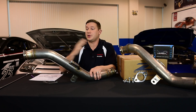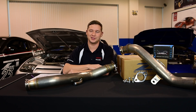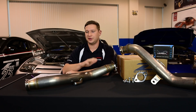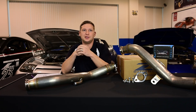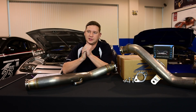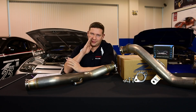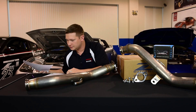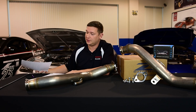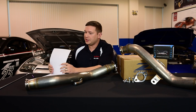We'll keep working on developing parts and won't abandon these. Stay tuned — these are going to be available, we'll try to keep them in stock ready to ship fast. As always, kits include gaskets and hardware. If you want to bundle it with an UpRev standard tune, we'll send you a cable and hook you up remotely with an e-tune. Our record number on the car was 444 horsepower and 608 lb-ft torque — that was on pump gas. We pulled it back for daily driving to 428 horsepower and 514 lb-ft.